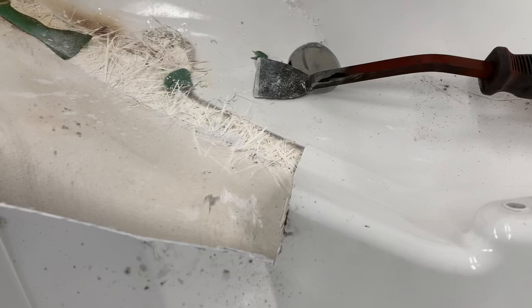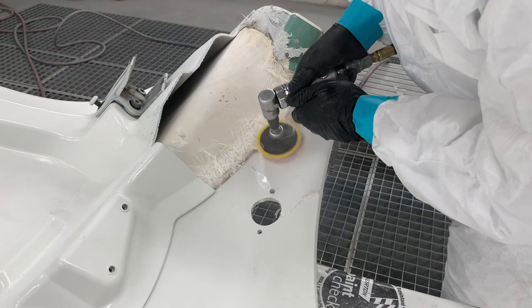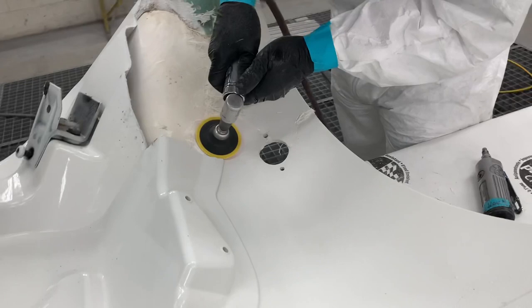As we complete the heating, the panel should come off with relative ease. If you haven't heated it enough and try pulling or chiseling too hard, you will crack the fiberglass or SMC panel. Once the panel is removed, look at how the seam came apart — you can see where the glue let go on one section and where it actually tore the fiberglass on another, which can happen due to the existing damage or improper heat usage and excessive force with a chisel.